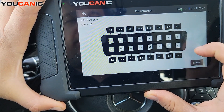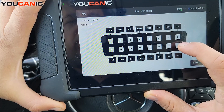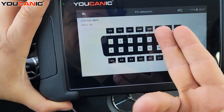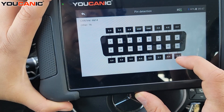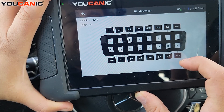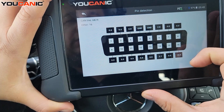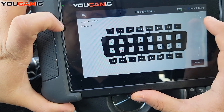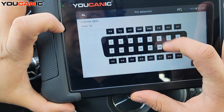Another important one is the battery voltage. Here we have 14.5 volts on pin 16. I would recommend looking up your own make and model to see which pins should have power. Sometimes you have a couple of pins that should have positive — one might be connected straight to the battery, and the other positive should be coming from the engine control unit. You might have power on one but not the other, so verify your grounds and which pins should have positive. The next thing to check is the CAN line — you can see here on the top left it says CAN line 6 and 14, the CAN high and CAN low. Those two are really what your communication goes through.